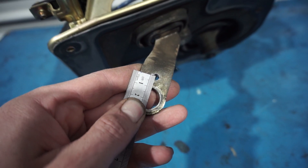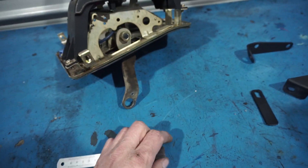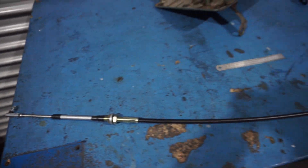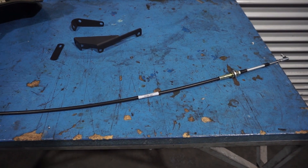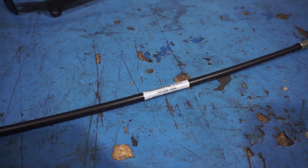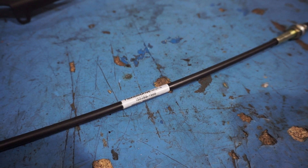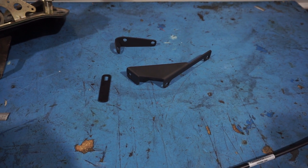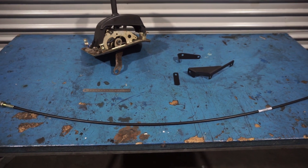Using the top of the larger hole for reference, 10mm above, we need to drill a 5mm hole. Once that's drilled we can refit the shifter and console. For the shifter cable we'll be using one from Flexi Drive — it's a push-pull style cable with rod ends similar to what you'd get in a B&M shifter. The part number is IS83BB-1500 and that's 1.5 meters long. We have all of the cable brackets CNC plasma cut — if anyone wants a set just send me a message.